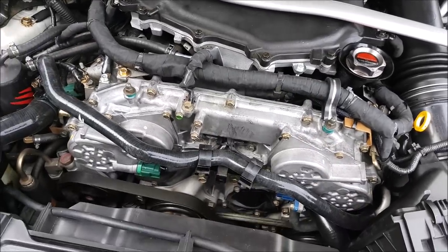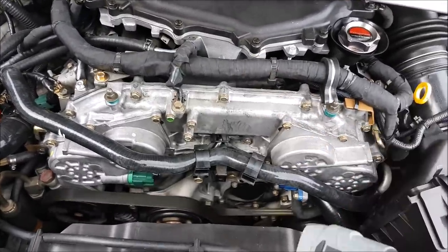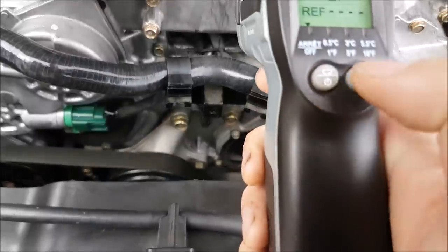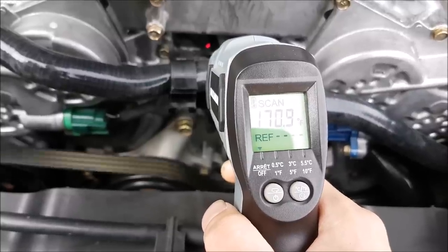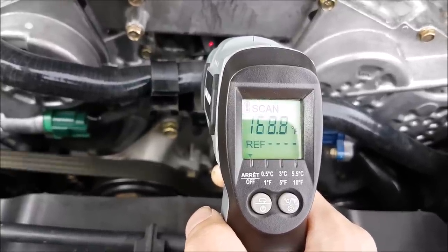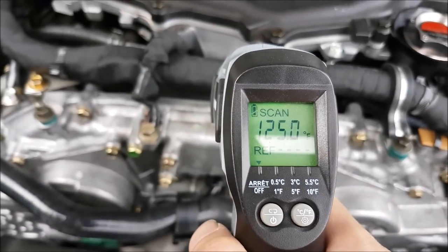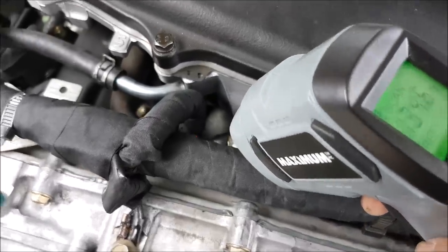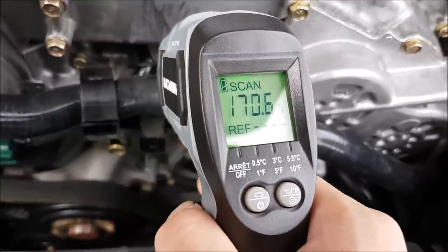Things you have to consider: if you're going for a track car, I would probably have your wiring out here if you're trying to get it as cool as possible. But it's not the end of the world down there. I'll switch it to Fahrenheit for you guys. This wire tape cover is rated at 400 degrees Fahrenheit of constant direct heat — so we're well under that. Technically with that upgrade up here we're well within our safe parameters. I was concerned about this area, so follow up — I'm taking this car for a long drive on Monday to see how it does.